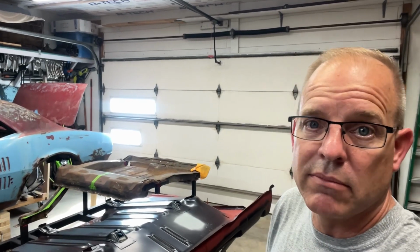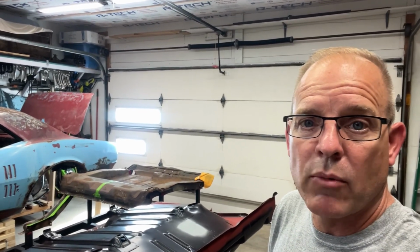Yeah, I know this is kind of a long video, but like I said, this is geared more for the first timers who are wondering what their next move is. And before you go jumping in and throwing that floor pan and the frame rails in, just a couple things if you want to get it prepped and ready to install. Like I said, I prep with a weld through primer. You don't have to. I'm sure your car will be just fine. A lot of people don't, but that's just what I do.